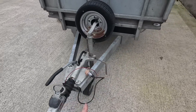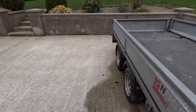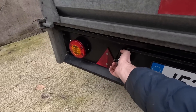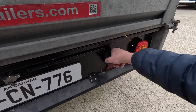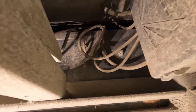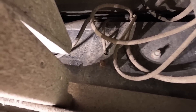Right, so that's that taken care of — that's going to leave things much safer. So the next thing we have to do is around the back here, which isn't a big problem but still is a problem. Our number plate light on this side has broken off. This one here hasn't worked in a while — I think it's full of water actually. I've just picked up two simple LED replacements for these and we're going to stick them on. There are two little bolts here and there — I'm going to spray some WD-40 on them and loosen them from this side, and that whole assembly should pop out.